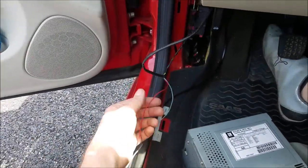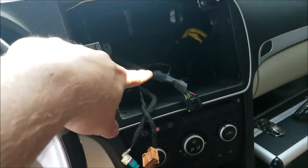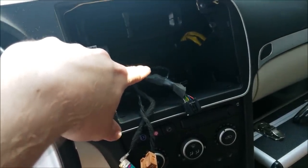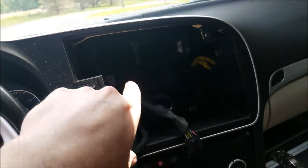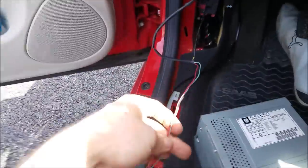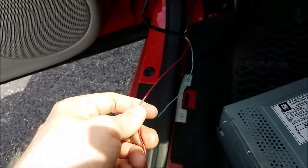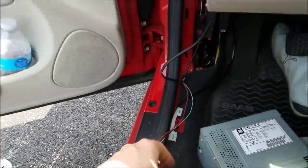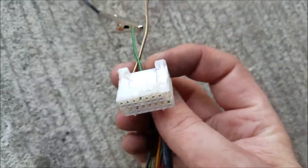As far as wire colors: the wires at the radio are green and gray. I had matching colors from a previous install. The green eventually switches to red because I ran out of green wire — so green at the radio goes to my red wire, and the gray goes to gray. Now I'm ready to put everything back and run the wire to the VCIM. Here's the modified connector I dremeled down — maybe a little too far, but no big deal.